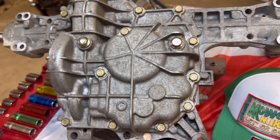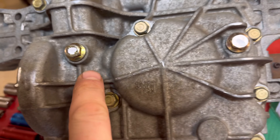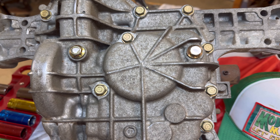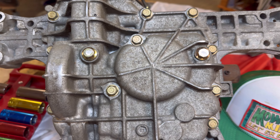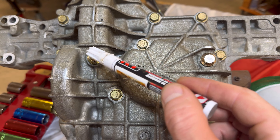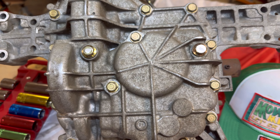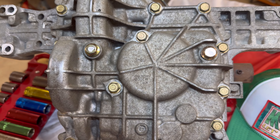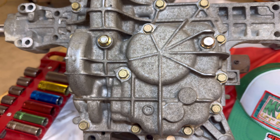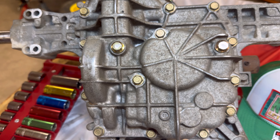I just want to show off my new fancy oil drains. They look damn professional — one right there, the other one right there. You can see where the boss is — these drains were always meant to go there in the first place. One thing you'll notice is that those drain plugs look like all the other bolts underneath that transmission, and there are about 50 of them. So what I've done, I went ahead and took a paint marker and just put a little dot of paint on each of the drain plugs, so I'm not undoing the actual transmission bolts when we change the oil. I hope that helped. I'm going to list all the videos down below from a full service to a quick service to install to removal. Mower Mike's out — catch you next time.